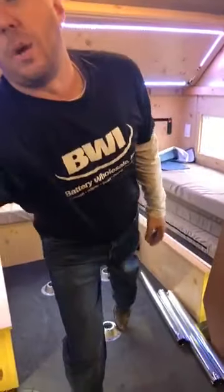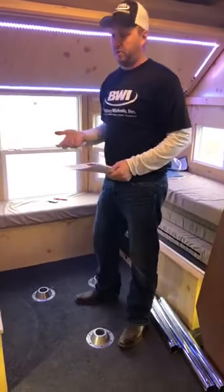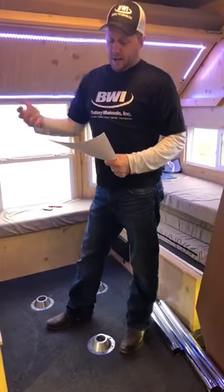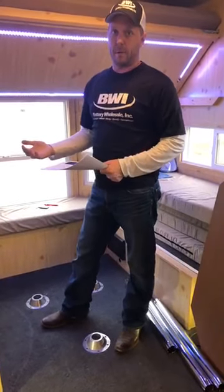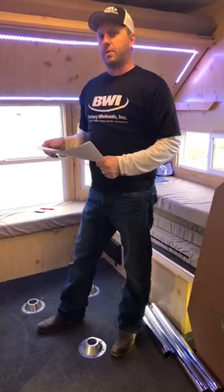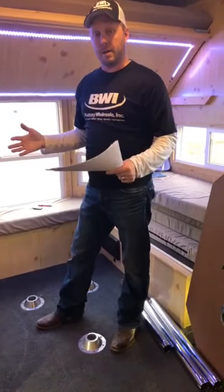I want to quickly talk a little more about amp hours of batteries. Your standard 24, the least expensive ones out there, like Exide's 24 MDP and Interstate's HD 24 MDP, are all right around 60 to 70 amp hours. That's typically what comes in the campers when you buy them new. You can go up to a Group 27, I believe, that fits into that white box they come in.